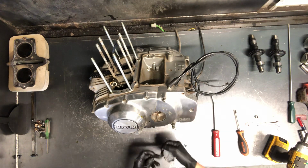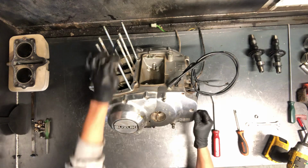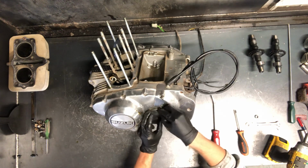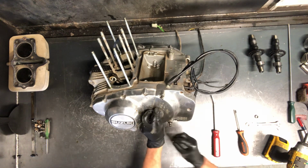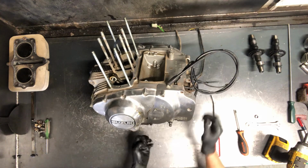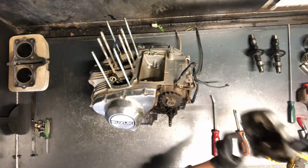There's your clutch adjust. So we've got a 10mm lock nut and a flathead screw to adjust your clutch rod, and I'll show you that when we get deeper into that motor, how that works there. Set this back on there. Here's your shift pattern here. Shifter is there, shift shaft. Now this cover's ready to come off.